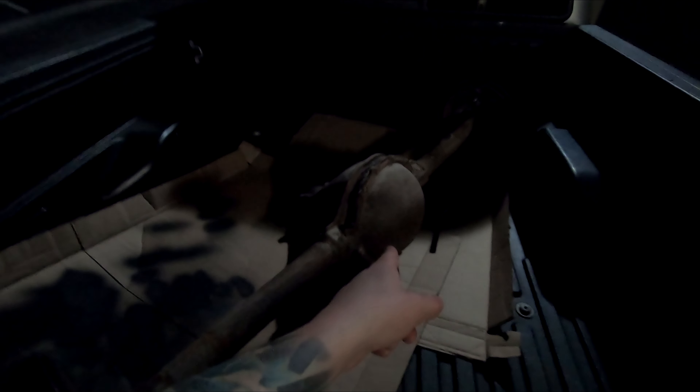Alright, so here is the rear axle. It's very dark out here, but this is going to the shop tomorrow to get totally rebuilt. I'm still debating whether I should get a new differential cover or not — I think I'll be okay with that one. Maybe just blast it and put it back on there. The rear axle is dropped off. They said it would probably be about next week when I get it back. They did say that they might be able to increase the preload on the clutch pack, which is part of the reason why these are notorious for wearing out so quickly. I asked them if there's something between the factory setting and like tripping the tires when you go around a corner, and they kind of brushed me off. So we'll see. Hopefully I have all the correct parts and everything and they don't need anything else.